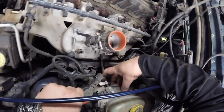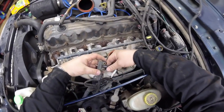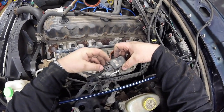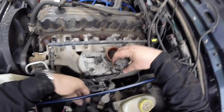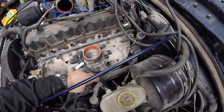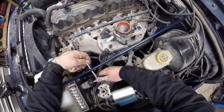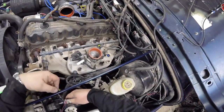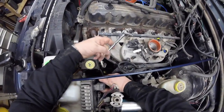I'm also going to be fixing this connector this time around. How many zip ties did I put on this? So I had the supercharger on — the sensor here, I had to relocate it, and unfortunately that's why the lock's busted. Once we get that out I got a spare one, going to take the parts and fix it. I'm going to pull the electrical off the back of the transmission control module because it'll make it a little bit easier when I go to remove this manifold — less stuff catching in the way.